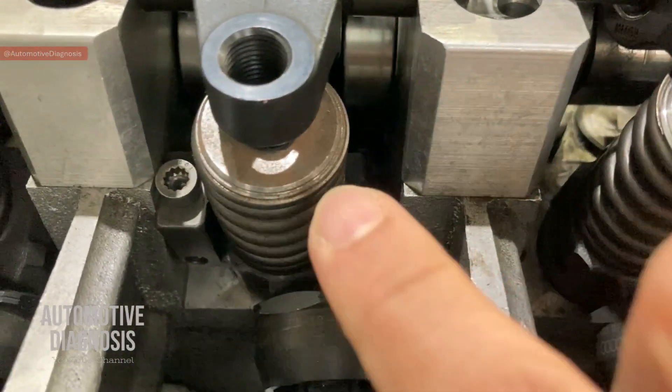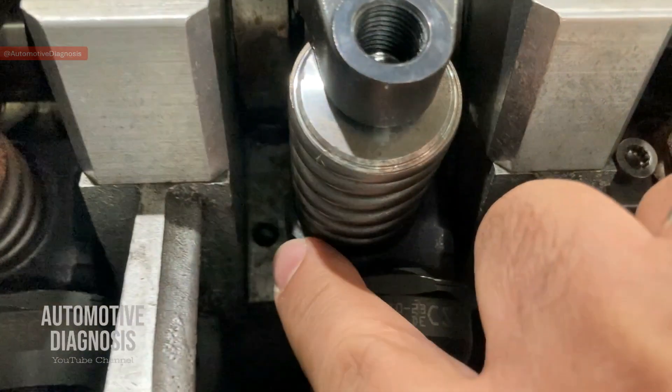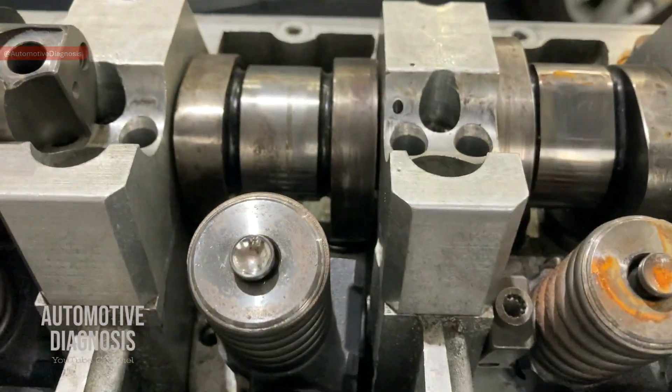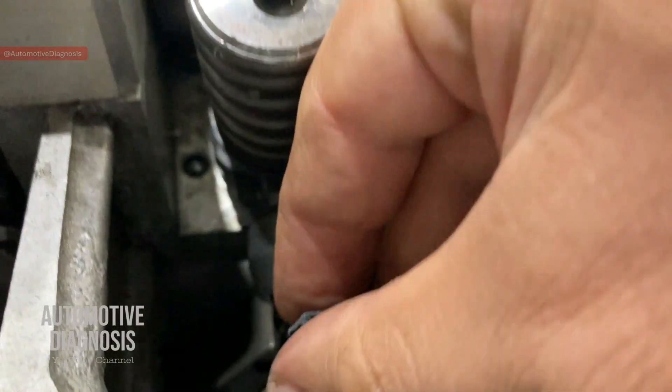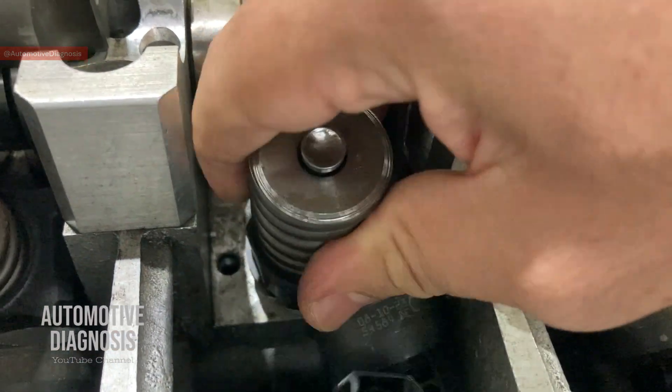For removing one injector - as you see, injectors are seated on the cylinder head exactly fitting the stopper. After removing the rocker arms, I've removed it from there. For this injector there's one connector - we need to take the connector out and carefully take the injector out.